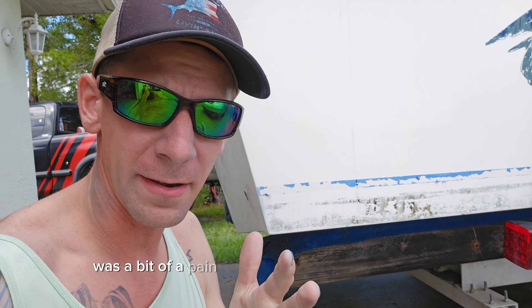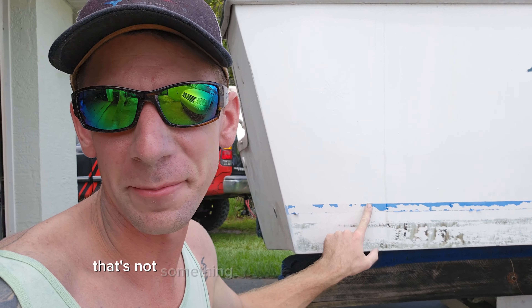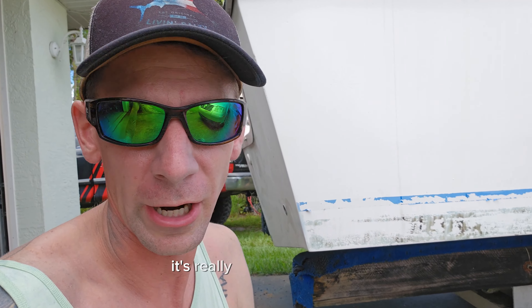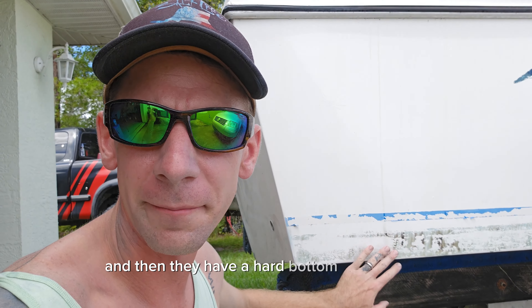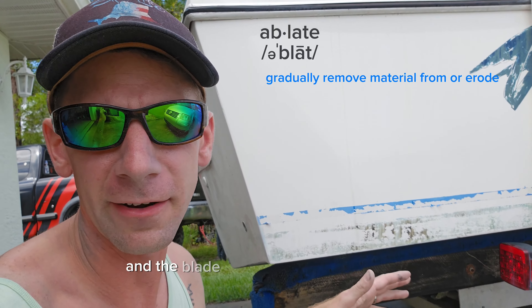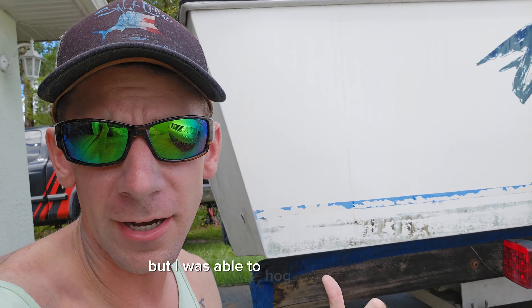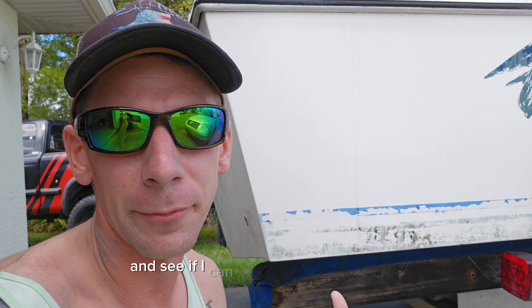It was a bit of a pain because a 45-year-old boot stripe — that's not something you use adhesive remover on. I tried pressure washing it off, but it's really hard and brittle, so I just sanded it with 80 grit. They also have a hard bottom paint over an ablative bottom paint, and the ablative was so old it wasn't ablating very much. But I was able to hog it off and get this thing ready for paint.